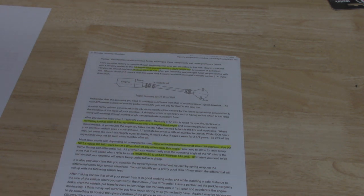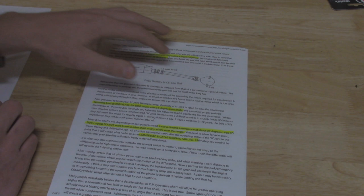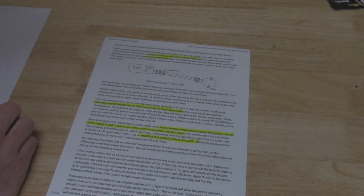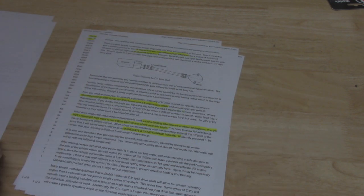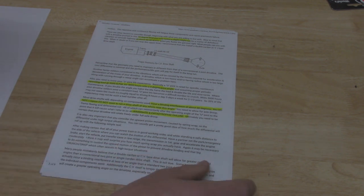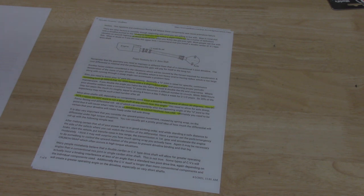If you go more than 3 degrees with the single U-joint, you might encounter driveshaft vibration. An interesting fact: at 3 degrees running at 3,000 RPM, you'll get 5,000 hours out of that U-joint. Increase the angle to 6 degrees and you cut that life in half — only 2,500 hours. At 15 degrees you'll notice vibration with nothing to correct it but fixing the angle. Absolutely do not go over 30 degrees in a U-joint — that's set up for immediate and catastrophic failure. You'll break U-joints, ruin axle bearings and seals, or break a driveshaft entirely.